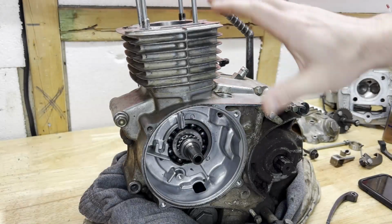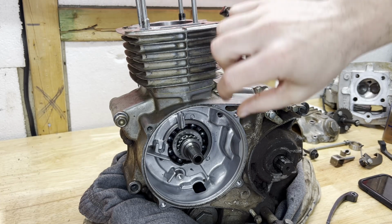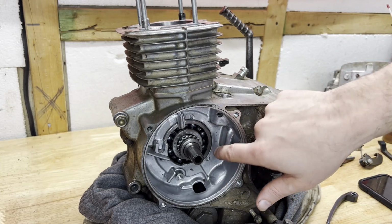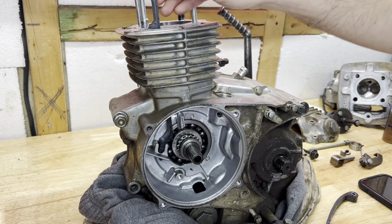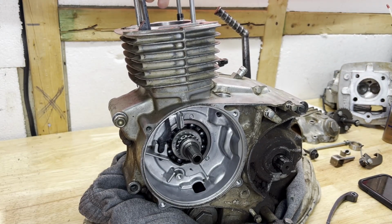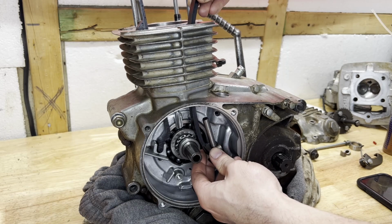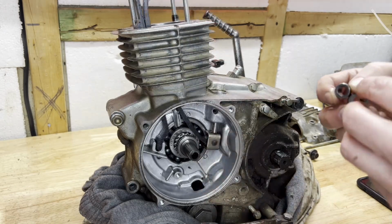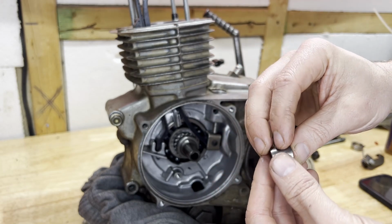So moving on, we got the cylinder on. We're gonna put the head on next. First, I'm gonna put the two cam chain guides in there, get them lined up in their spots here. I'm gonna put the tensioner adjuster back in, and then we'll get the cam in and then fish the chain through. These lock spacers in here, can't forget those.